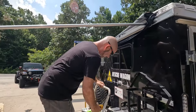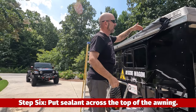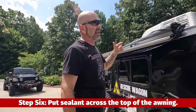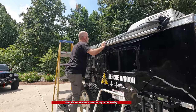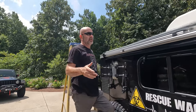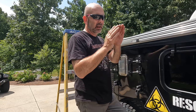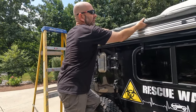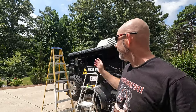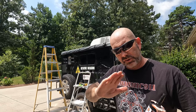The next step is going to be to put some sealant across the top. I did it with silicone on the last one and it worked pretty good for a while, but then after a while it started to leak. I'm not sure whether I want to use silicone, or maybe that Flex Seal I just got, or a lap sealant to make it wider like on an RV roof. I've decided I'm gonna use the Flex Seal on this side and then go back over the other side as well. I'm gonna lay a thick bead down right where they meet and then push it in with my thumb and spread it out.